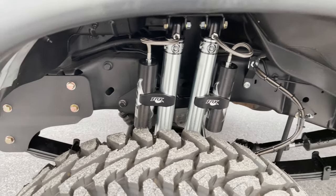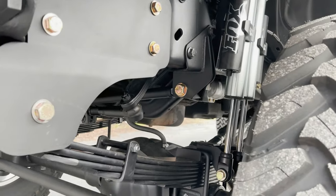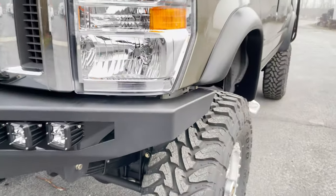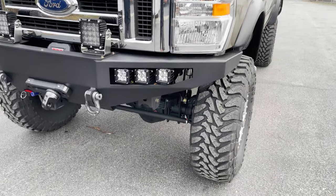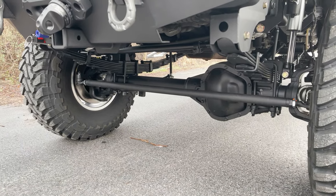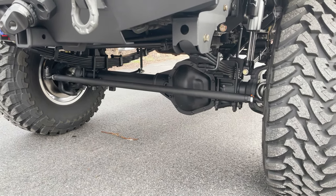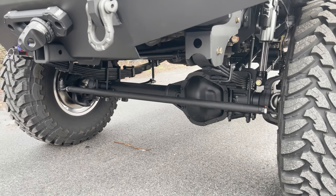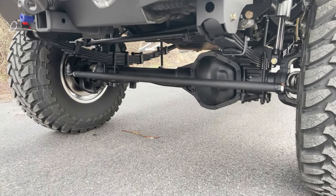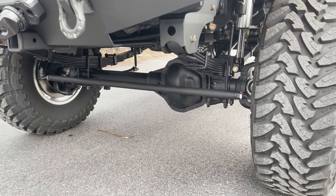It went with the Fox dual shock upgrade. As you can see, we cut the whole bucket off and weld our shock mount on it — though you can't really see because the track bar bracket's in the way. Full 8-inch lift front and rear. Stage 2 front axle, 4.56 gears with the TrueTrack and RSC upgrade. This van did not require the RSC upgrade but we did it anyway to get the hardware. So it's got the big 14.5-inch diameter rotors, serviceable wheel bearings, 35-spline stub shafts — all those parts sourced from our buddies at Dynatrack.